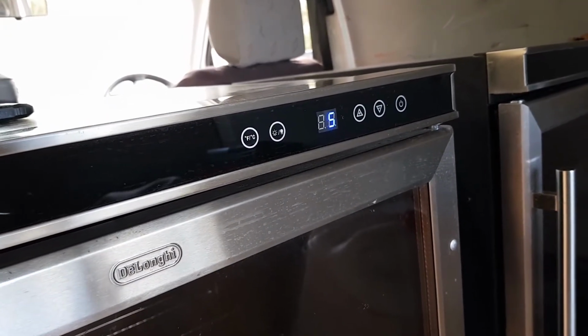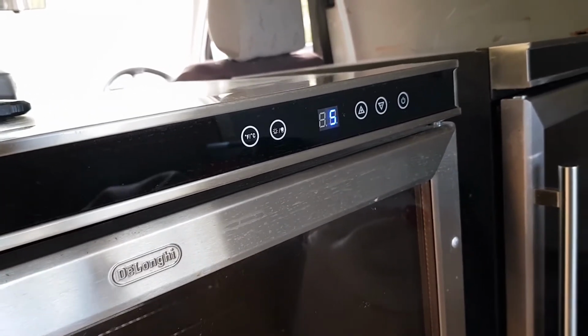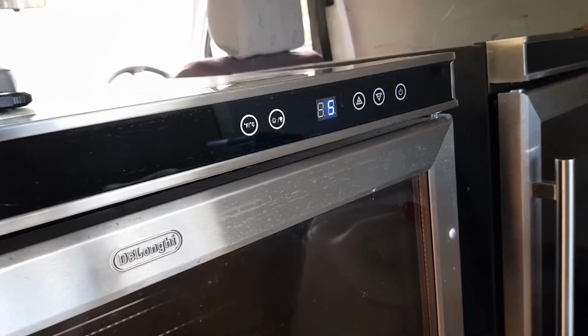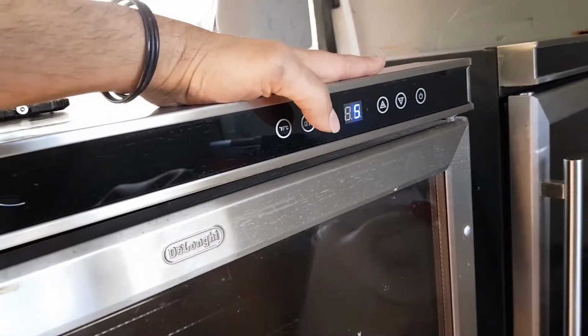That's when the compressor stops. So it'll probably stop in a few seconds. And what happens is, as the temperature inside rises, when that gets to 8, the compressor comes back on. That's how all fridges work, and mechanically it works great. But we still got this.